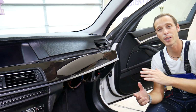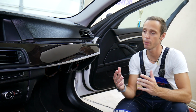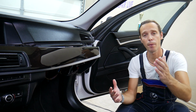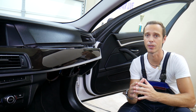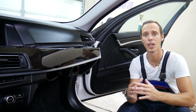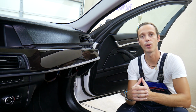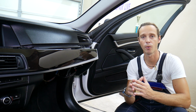On these new cars, it's very important which battery terminal you disconnect first. If you do it the wrong way, you can cause damage to the electrical system, modules, computers. How do we know that? We burned the airbag module computer on a Mercedes. That itself cost us $2,000. So check out the video that explains which battery terminal to disconnect first and which battery terminal to connect first. All that will be on our channel, guys. You can find out more about it.